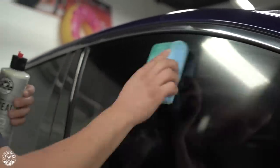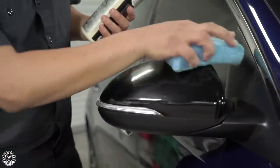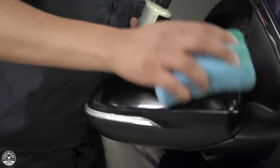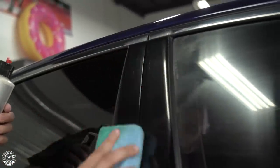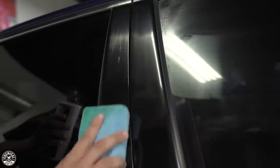Now that we're done coating the glass, we're going to let that sit and marinate — let it flash for up to 15 to 20 minutes. You want to give that sealant time to break down and settle within the pores of the surface, so it creates a shield of UV protection and shine. Not only does this work on glass, it also works on clear optical plastics or glossy plastics, such as this mirror cover. I didn't have to apply any more product — this cream goes a very long way. We applied it to the glass, and we can apply it to the glossy B pillars as well. If you have matte surfaces, use JetSeal Matte instead, because this version is meant for glossy surfaces. Protecting the B pillars will prevent them from fading and oxidizing — a lot of cars out there have faded pillars, and this is the leading cause.